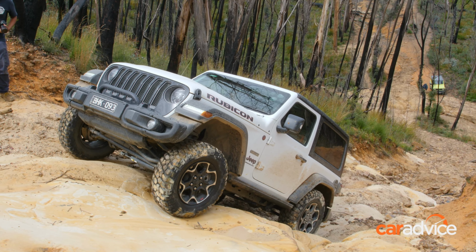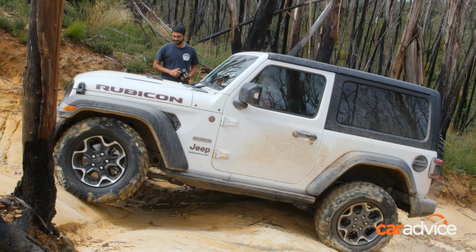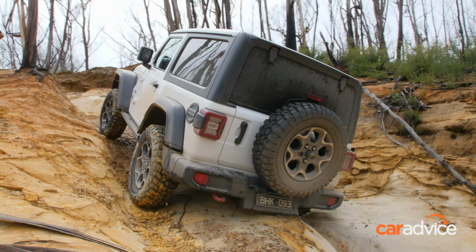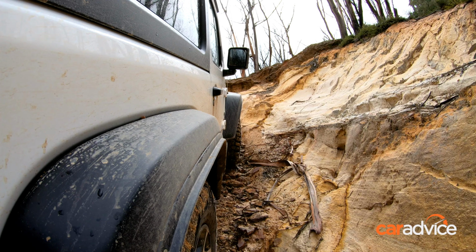That was impressive. Barely slipped at all. The tyres are at 15 psi roughly all around. Just crawled up. Not a drama at all. There we go, just slow wheel speed, gentle throttle. You can feel the tires gripping into the earth.